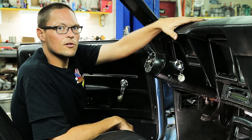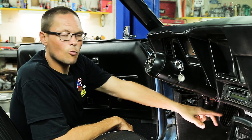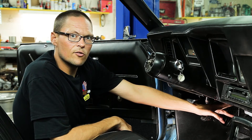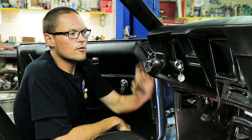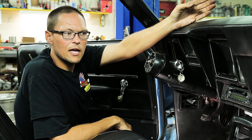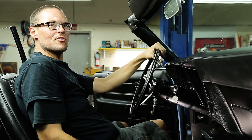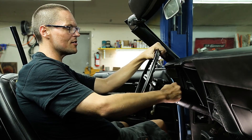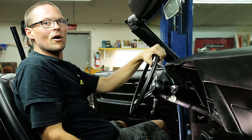Now that the battery source is hooked up in the engine compartment, we need to move inside and hook up the ignition hot wire coming from the module. It's going to go over to the fuse panel into an open slot with ignition hot. After that, the steering wheel is going to need to be put on, then we reinstall the battery cable, and then we can try our new system. Now that we've installed our ePass system, we need to try the ignition hot to make sure the system works. There's the click. Thank you for watching our video.